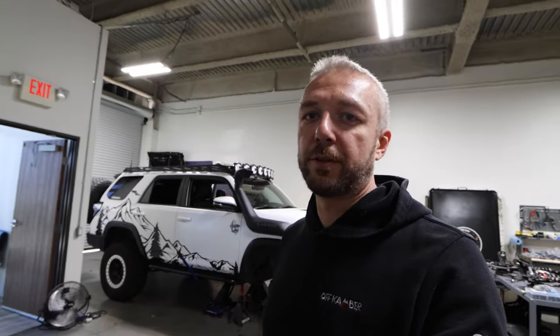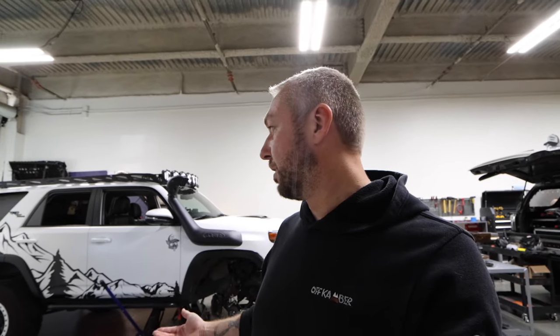My goal is to show you how to figure out exactly what steps you need to take for your vehicle. In essence, the point is this: once you install everything, you need to take your shocks off, take your coils off, jack up your tires, and adjust your bump stops appropriately to where you want your vehicle to stop. Give it an extra half inch or so because they're squishy. Then turn your tire left and right, see what you're hitting, cut and grind, and do the same thing over and over again.